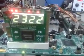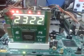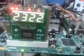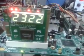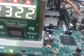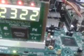There is a beep sound on the Intel D945GCCR motherboard. The problem is with the RAM — the RAM is not connected correctly to the motherboard, or the RAM is damaged, or the motherboard does not support the RAM.